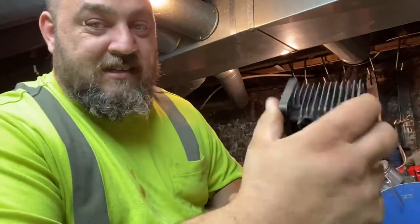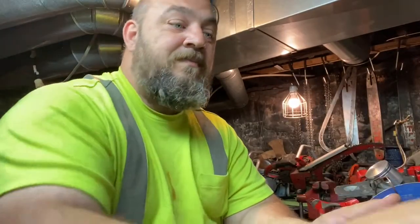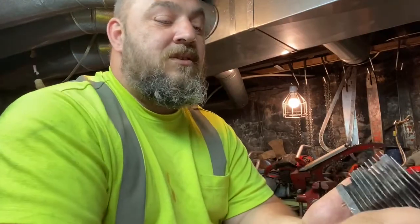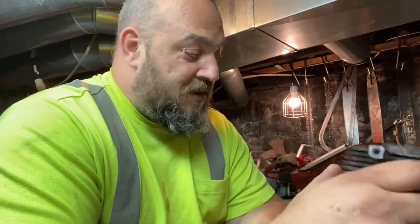Now, with a saw like this, it needs help in order to do that. So we started out with 103 degrees. What that was, here's my notes. Started out at 103 degrees at 87 thousandths of squish. Now 103, I actually like it at 103. These Super XL Autos seem to really run well at 103 degrees. They do. I would not go further than that unless you plan on doing something about your squish.